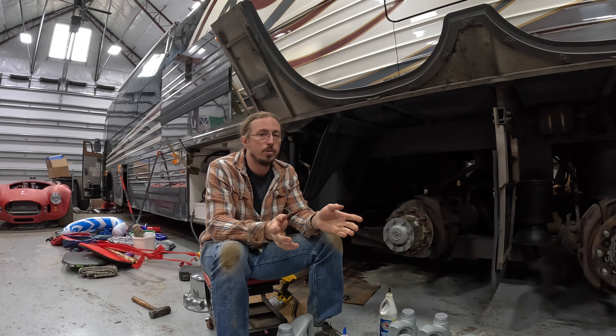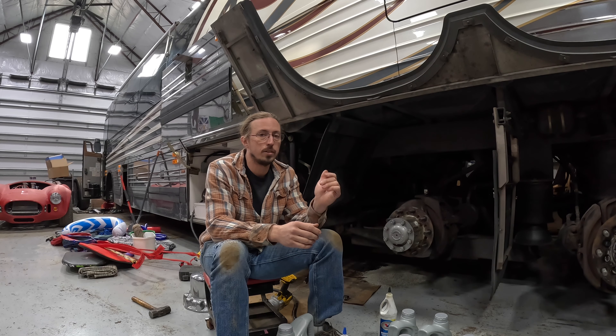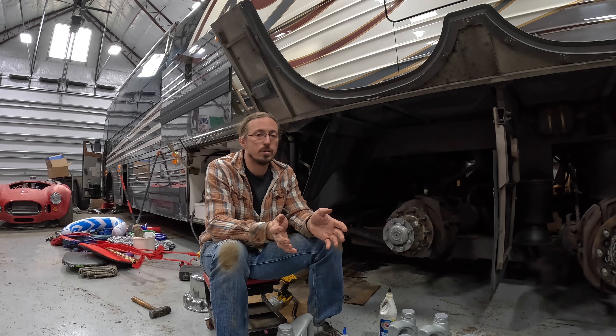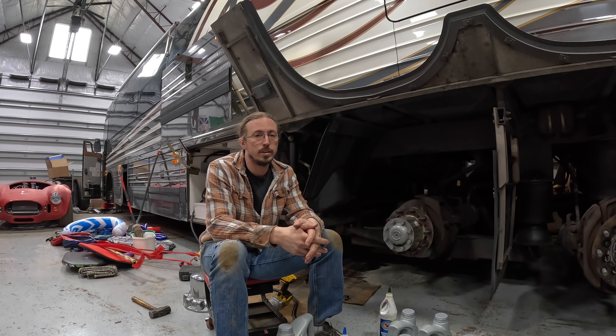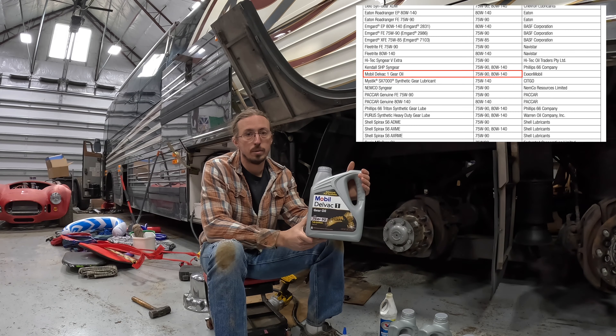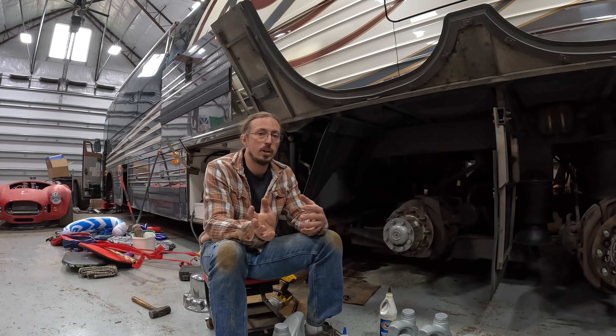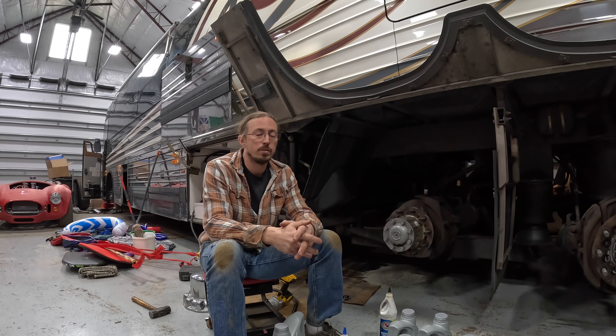It might also surprise you to know how often you're supposed to check and change your differential oil. The manuals say you should be changing it every two years or a hundred thousand miles, whichever comes first. In my case, I have a strong suspicion this is probably the original differential oil at about 23 years — my bus has about a hundred thousand miles on it, so it probably should just be changed. Meritor actually says you should change it yearly, but if you go with a synthetic oil from their recommended list — I went with Mobil Delvac gear oil — they say you can extend the change interval to three to four years. I decided to go with the oil Meritor recommends since they made the axle.